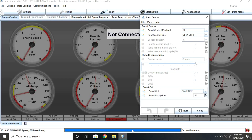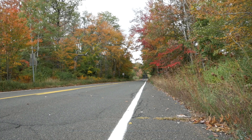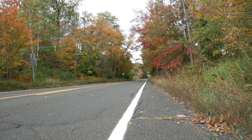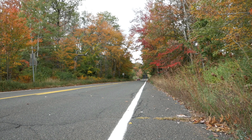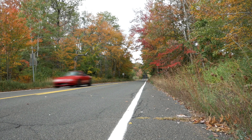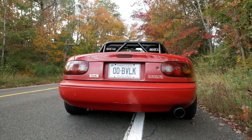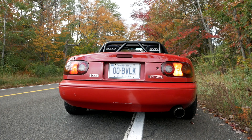This will bring your value from gauge pressure — which is the target boost that you want — to absolute pressure, which is gauge pressure plus atmospheric pressure. I'd recommend starting low and working your way up, at least for a newly turboed engine or for your first time using this feature. Go out and drive it and that way you'll know that it is working.